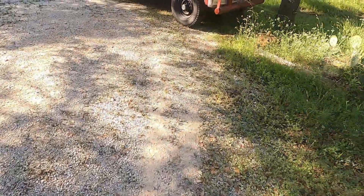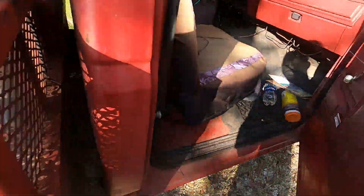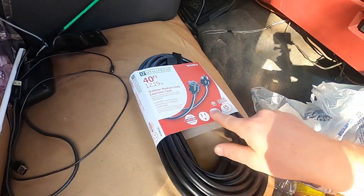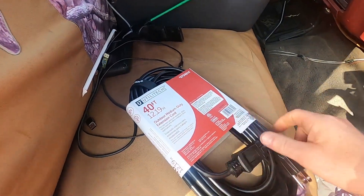I've done this sort of thing before. I need three wires going to each door: two positive and one ground. What has three wires built into it already? That's right — an extension cord, 14-3. That should be able to carry the load, so we're just going to cut the ends off.